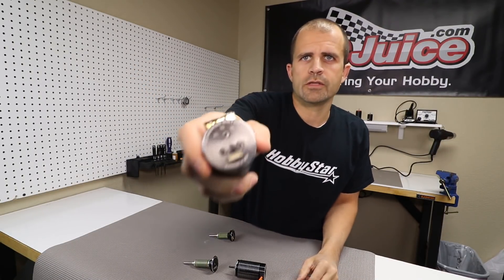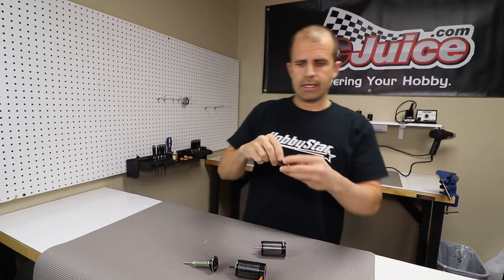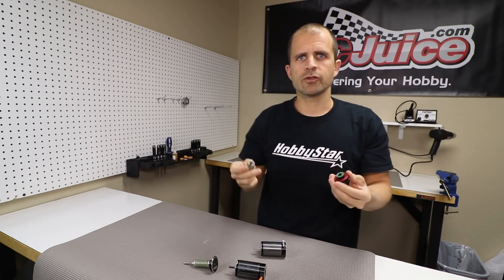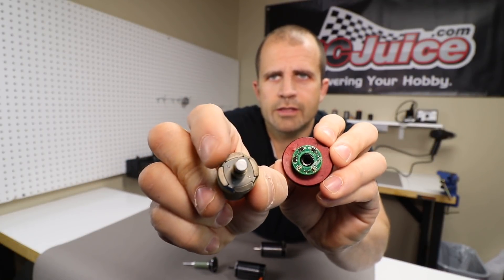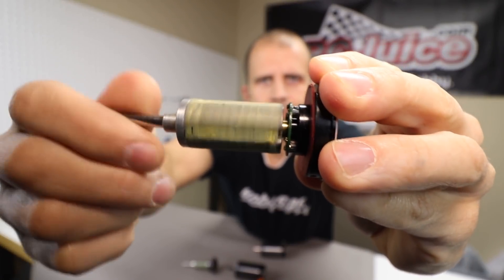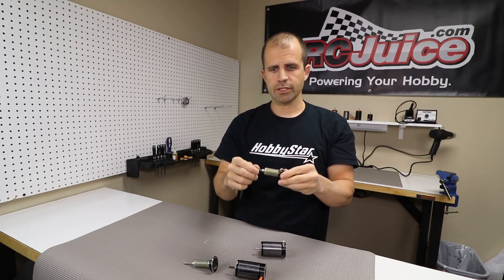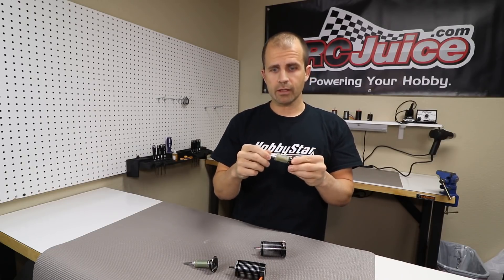When we look at a sensored motor, it's always going to have a sensor port on it somewhere for the sensor wire to plug into, with the other end plugging into your ESC. The important pieces inside — these little guys here, see if we can zoom in — these are called hall effect sensors. A hall effect sensor is essentially a little transducer that varies its electronic output based on the magnetic field around it. So when you've got these individual magnets going past these hall effect sensors and your sensor harness is plugged in going to your speed control, the magnetic force being generated by these hall effect sensors tells the ESC exactly what position this rotor is in. The ESC now knows the overall position of that cycle needed for your motor to run — it knows exactly where this rotor is.